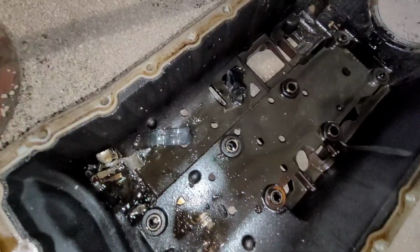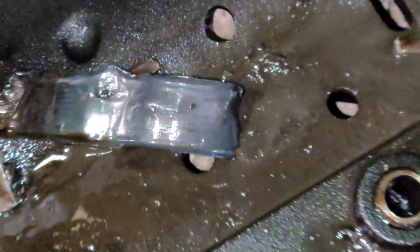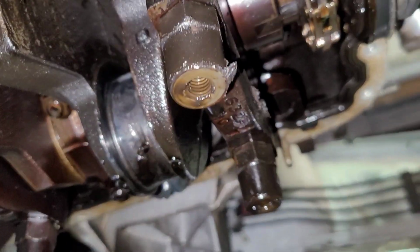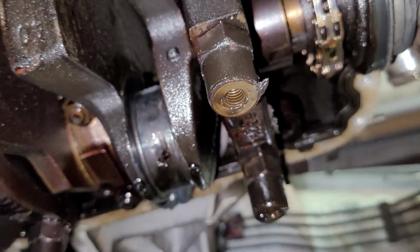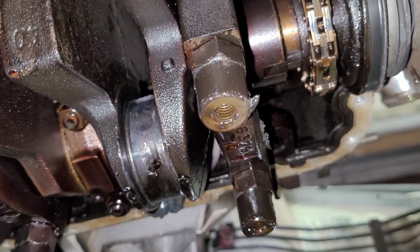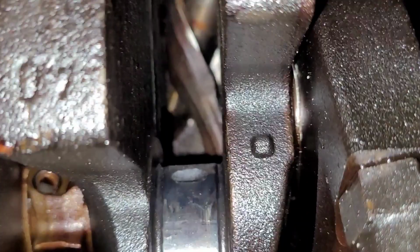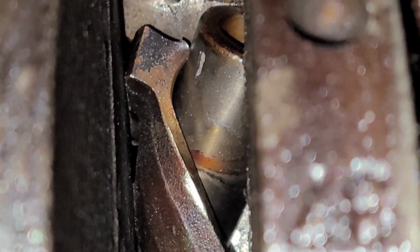And there it is, and you can see there's some debris in there, crushed up bearings and material and stuff like that, and pieces of a piston. And nice enough, when you come up here, I find this kind of cool. Oh, and I was wrong. Those bolts going through the pan, they just go into the cap bolts. I thought it was a 4-bolt main, but it's not. I don't know why I was thinking that, but whatever. Anyway, look up in there. How cool is that?